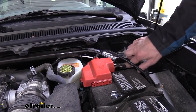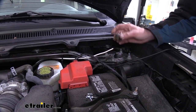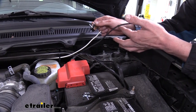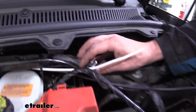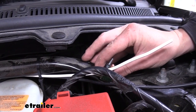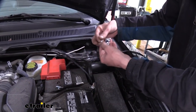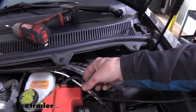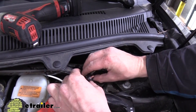We're going to mount our circuit breakers on the strut tower area. You get three circuit breakers in your kit: a 20A, 30A, and 40A. We're going to use the 30 and the 40 — not the 20. The 30A is for power for our brake controller and connects to our white wire. The 40A is for power for our charge line that goes back to the 7-way. We're mounting them right onto this brace for a nice close shot to the battery — closer to the battery is better. Using a self-tapping screw through the bracket and a quarter-inch socket to tighten, we'll avoid the wiring harness that runs through that area.